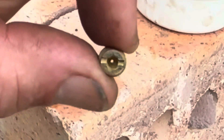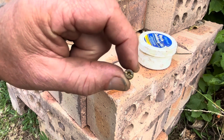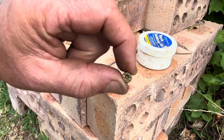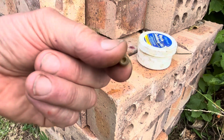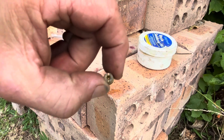All right, you can see the hole through the center of this high speed jet. I've just run my drill through the center of that, same size. I just scraped it in and out a few times just to make sure that the brass in the hole where I'm going to be soldering is nice and clean. The solder will adhere much better to it. You don't want grease or old petrol or anything like that in the hole where you're going to be soldering.